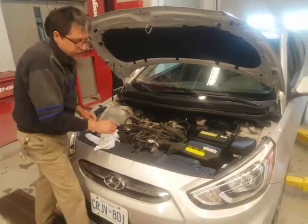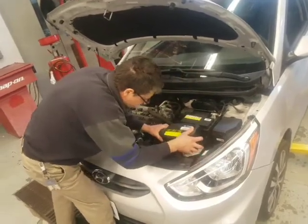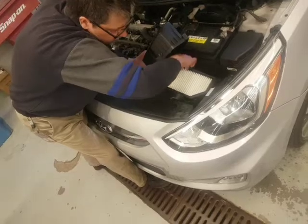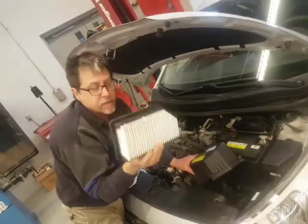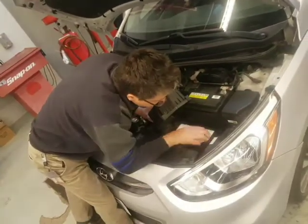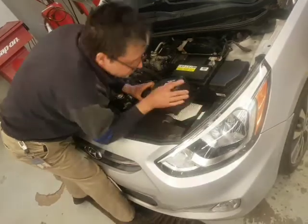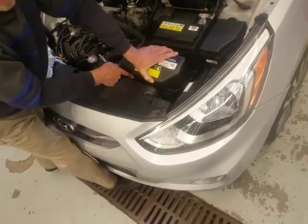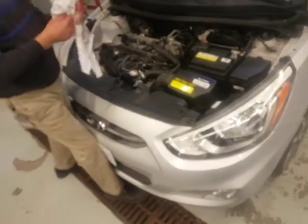The last thing you can check is the air filter. Remove the tabs and it just tips up. The top will always look clean — it's the bottom we're interested in, the part that's been filtering the air. Take it out and look at the bottom. This one is brand new. We hold it up to the light or the sun — if you can see light through the filter, it's fine. We're going to stick it back in. It goes in with the notch in the corner aligned. Put fingers at the back, line them up, and it should plop down. Snap the clips on — if you can't, it's not properly engaged on the other side. Everything here is beautiful, checked, re-sealed.